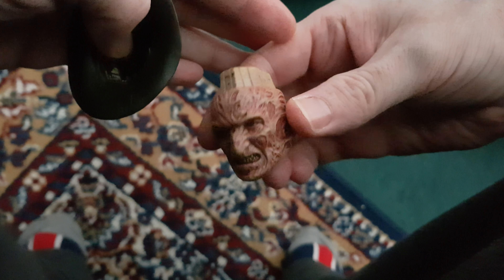That's how you get the hat off — pretty easy. Just use a heater or a hairdryer to heat it up, then use something blunt like a screwdriver. Do it at the back — don't do it at the front or the sides. When the glue is nice and soft from the heat, just pry it off. You don't want to risk damaging the paint job, but as you can see, nothing's been damaged.